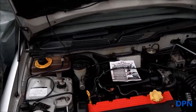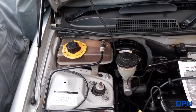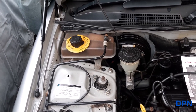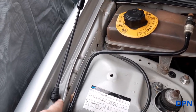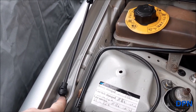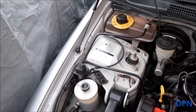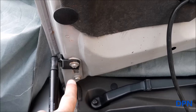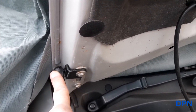Right, so we're now at the bonnet of the car, and what we've done is fitted one leg, because I think it's actually useful to see what it looks like visually as we're fitting it. It's also given us a chance to fit one before we film it. As you can see, the little ball bolt that you've got with the kit goes into the middle bolt of the wing, and then the little black bracket is going on the top bolt of the hinge, and you see this goes there like that.